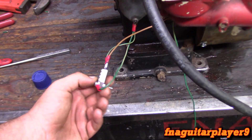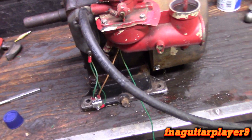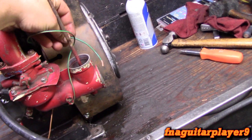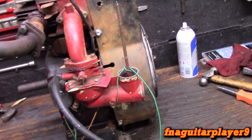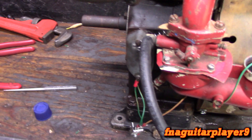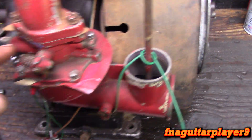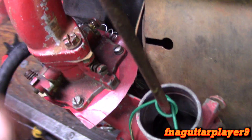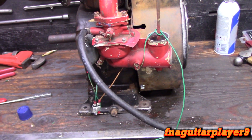This exhaust is temporary just to get it running. This is my shutoff wire in case I need to kill it — put it up here so I can get to it easier. I think it might run; we'll just have to find out. I already did a test crank, wrapped the rope under it and sprayed a little carburetor cleaner and it hit on it. I put a spring on the choke and I'm using it to put friction on the throttle so it shouldn't try to race. So let's see what happens.